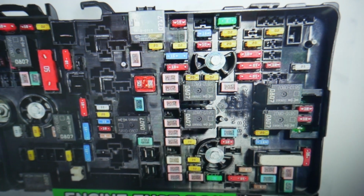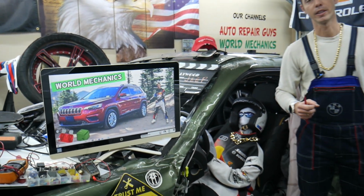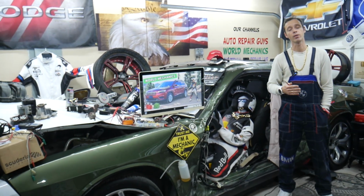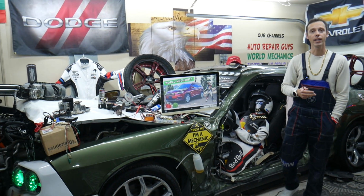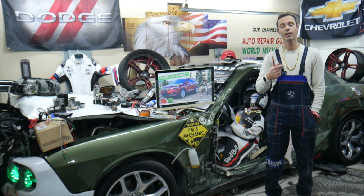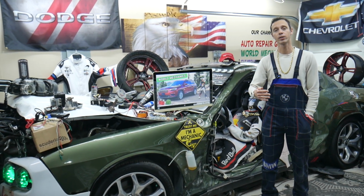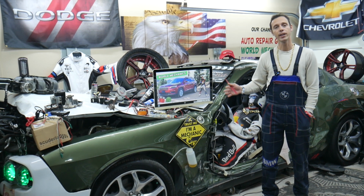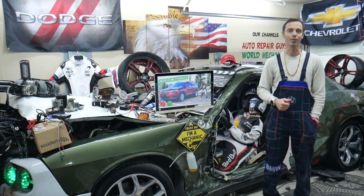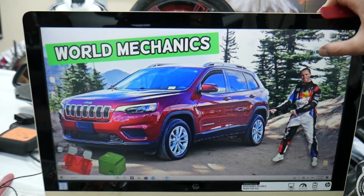But if you have problems with the headlights not working, often it will be controlled by the BCM. So you may need to reset the codes in order for the headlight to work correctly again. Many Chrysler, Jeep, Dodge vehicles use that technique, guys. So you may need to disconnect the battery, or if that doesn't work, disconnect it for 1 hour. If it doesn't work, you may need to connect an OBD scanner, reset the BCM module, and see if that will fix the problem.